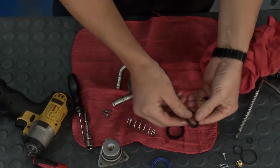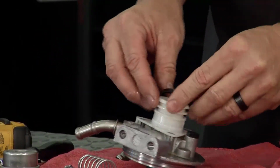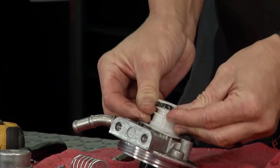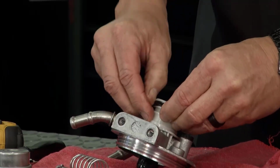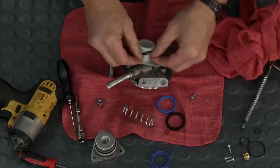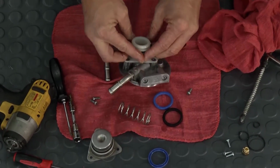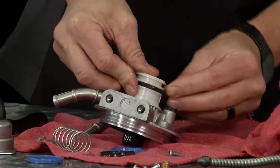Okay. Now the lip seal is located right here. You want the lip seal down on the bottom one. So I'll work that one on. So it's going down on the bottom one. We'll go all the way down to the second one down there. Walk it down. Just be gentle. Get the seal in the facing down position all the way around.